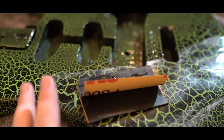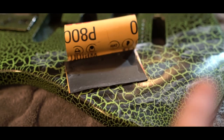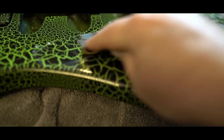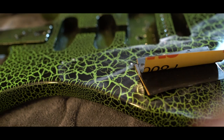We just did our second coat of clear — two whole cans on here. I think that's all we're going to need. I have this light at a steep angle, shining down so I can see all the grooves and know when this starts to smooth out. I'm using 800 grit paper to start with, then we're going to go up to 1,000, 1,500, 2,000, 2,500, maybe 3,000. And then we're going to actually polish this thing. You can see how there's these little ridges, and up here they're starting to disappear — we just have to go until they're all gone. At this point there should be enough clear on here that we can get rid of the bumpiness without fear of burning through. I'll show you how it looks when I'm done with the 800 and have it all cleaned off.